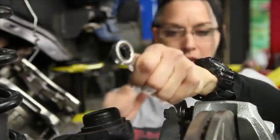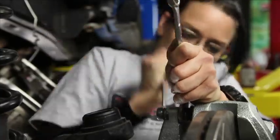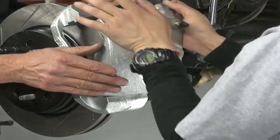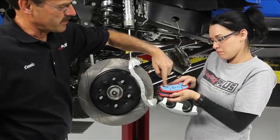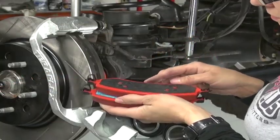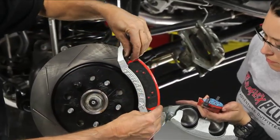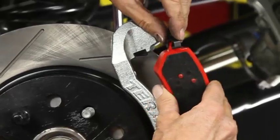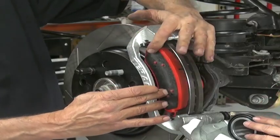You'll find that when you get to the end, that bolt is still not going to come out of that piston because the Loctite holds it in place. It'll wind out and you'll still have to push it out of the way a little bit to get the caliper to slide back. Swing the caliper out of the way — now we've got all the room in the world to put the disc pads in. These disc pads have got some blue material covering the anti-rattle, anti-squeak pads on the back. Just peel that off and it's ready to go.